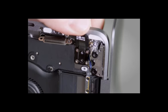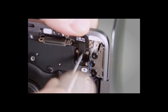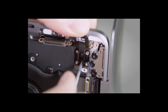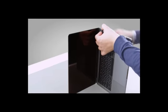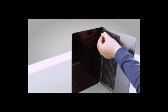Gently hold the alignment tool in place, but don't press down. Use light downward pressure on the edge guide while reinstalling the two center screws in the middle of the flexure. Remove the alignment tool and the edge guide. Make sure that any disconnected cables are tucked into the top case. Then, place the computer flat on the table.